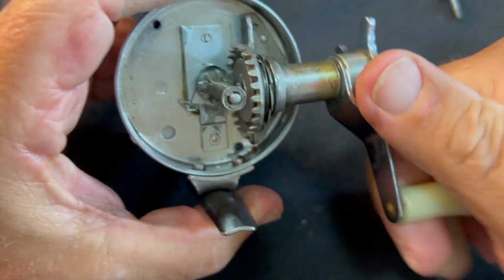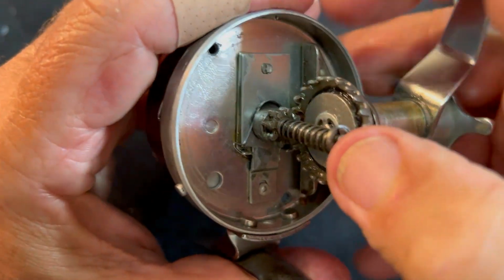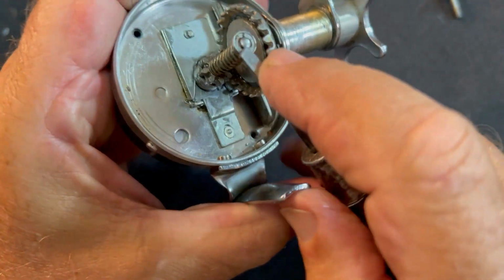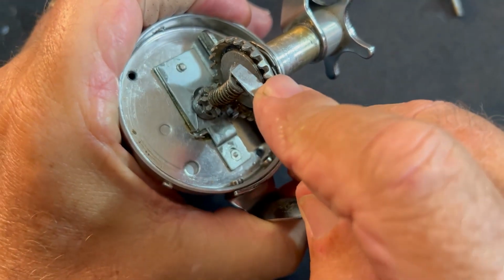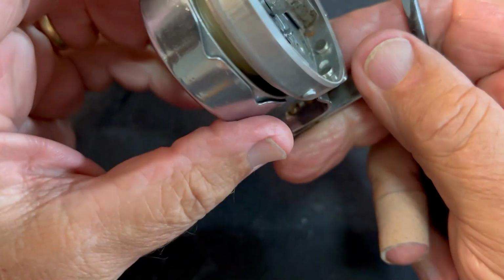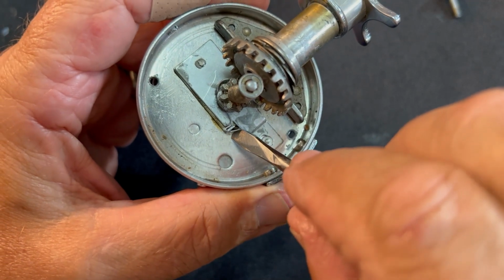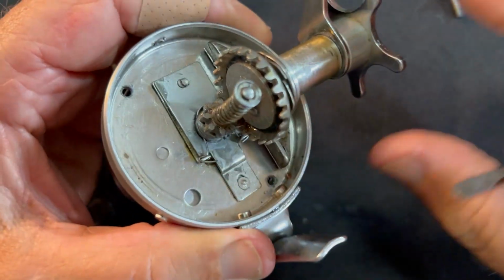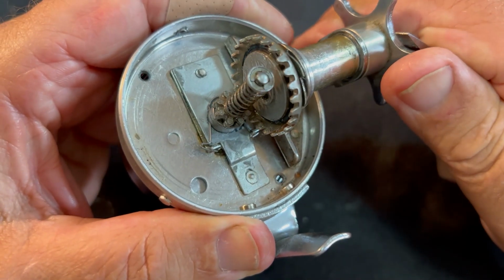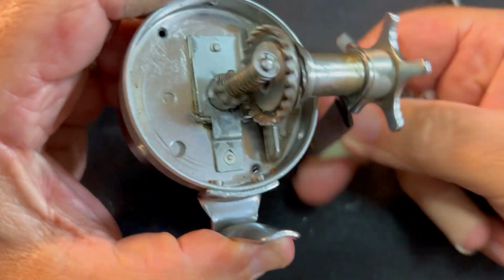Okay. There we go. Now it winds. All right, now if you watch that spring right there as we push in the axle shaft. Okay, it goes in to the point where it locks out right here. Watch it right here. It's come back down and it's sitting in position. It's in the lockout position right now. Now watch as I wind it. The axle shaft's going to push it back out to where it needs to be, and it drops back into place. Now we've got it down, and that's how it works.